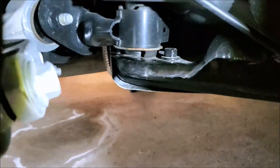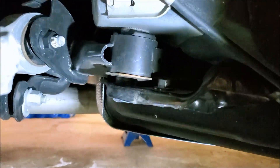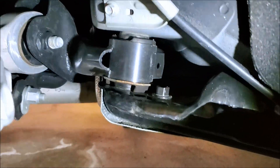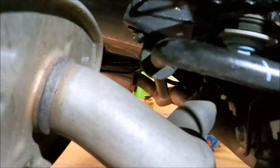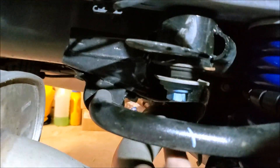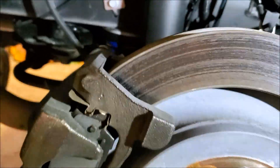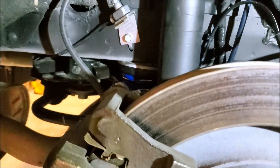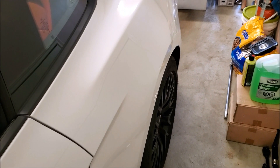Back's done. Put your brake line bracket bolt back in, torque your subframe bolts to 129 foot-pounds — one on each side — and torque the two 13mm bolts as well. Throw your wheel on and the back is complete.